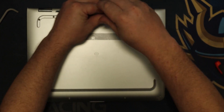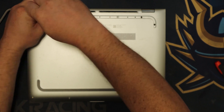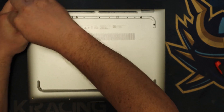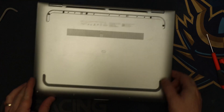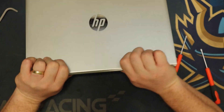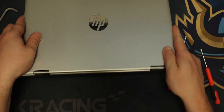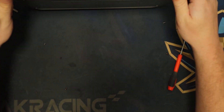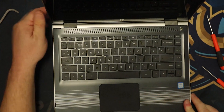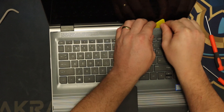The first thing you're going to do is remove that rubber strip along the top near the hinge, then remove the four grey plugs on the opening side to expose all of the screws. There are four screws along the opening side and five up along the hinge side. Once you've got them undone, flip it over and give it a shake. Not all the screws will come out, so don't stress — those that are stuck will probably stay in there. Get a couple of guitar picks and work your way around the edge.